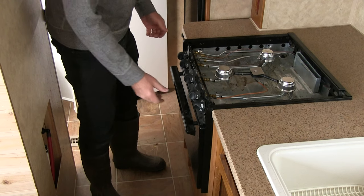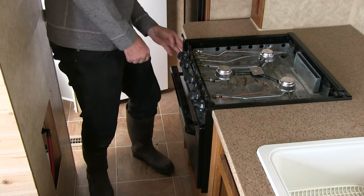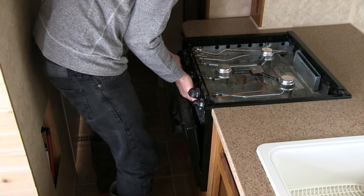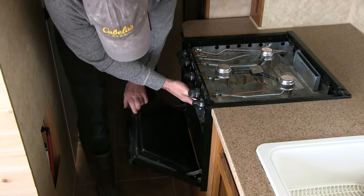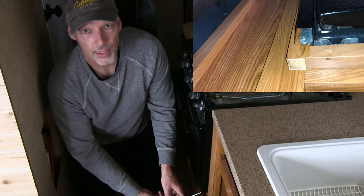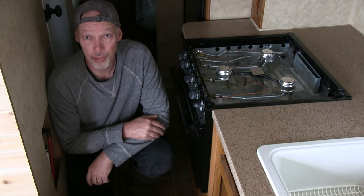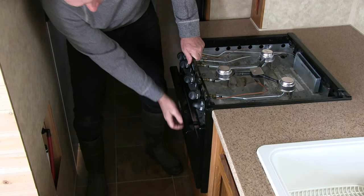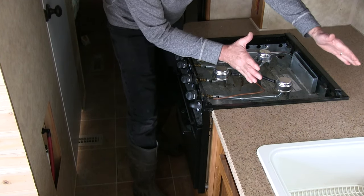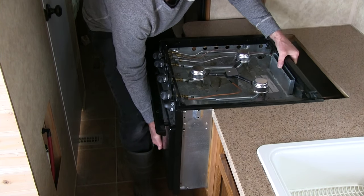Alright, let's try to pull this out. I'm not sure where to grab it — parts of it are fragile. As far as I know, it's just those four screws. I think this is part of the hinge. I'm thinking it pulls straight out because of this copper tube for the gas. There's a screw on the bottom left and right-hand corner that I need to take out. The copper gas line means the stove needs to come straight out because of the pipe for the gas in the hole. Trying to grab it where there's structure.